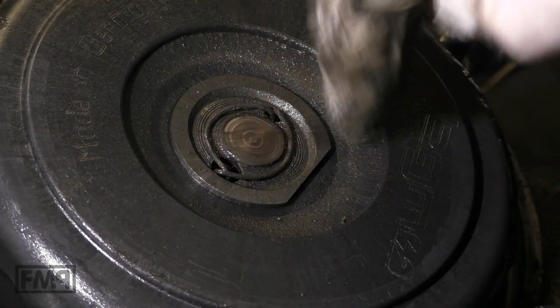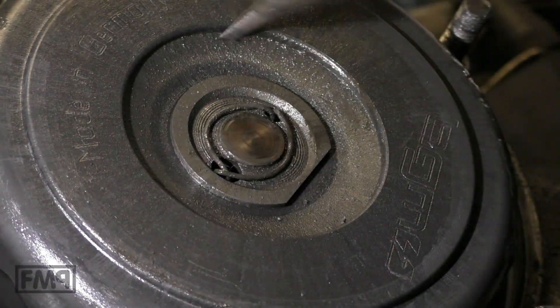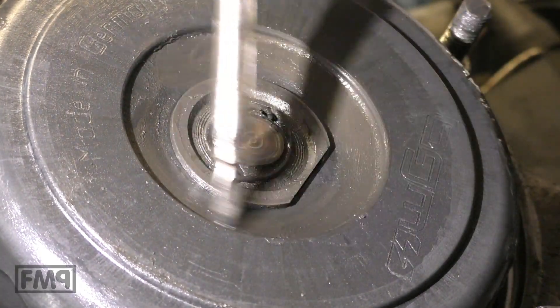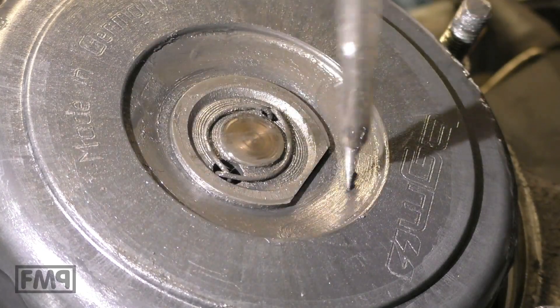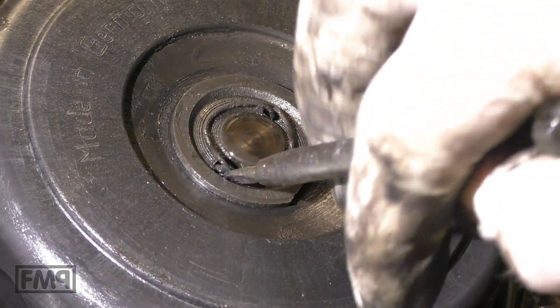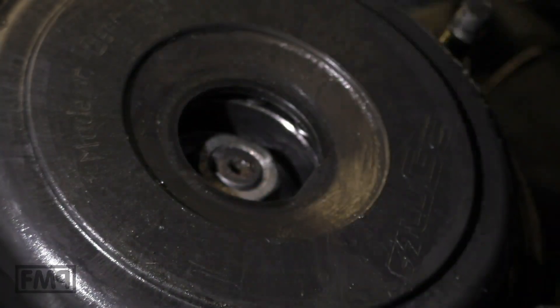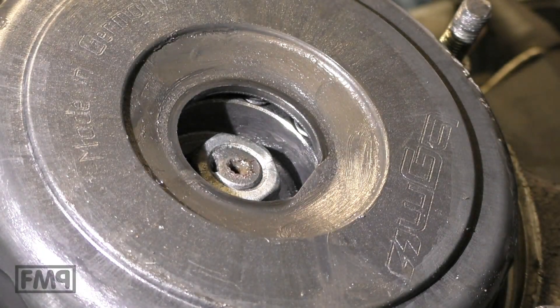Push rod still fine, but you also see here there is still grease, so it was not washed away. So there is no oil on this side with the 200 clutch, as it is way bigger. There was oil when there was the smaller 125, but not this one.